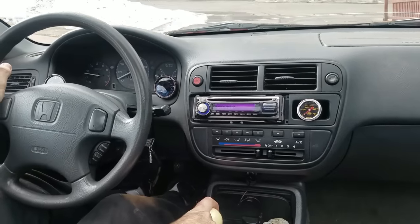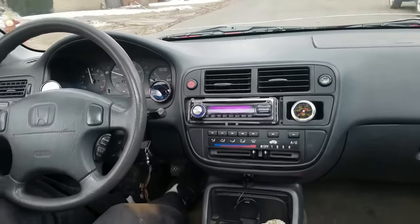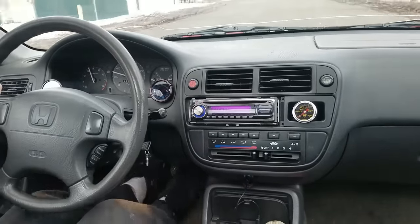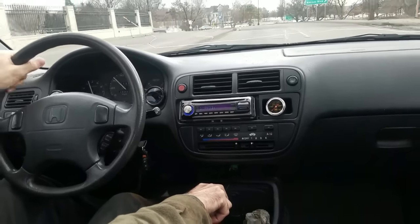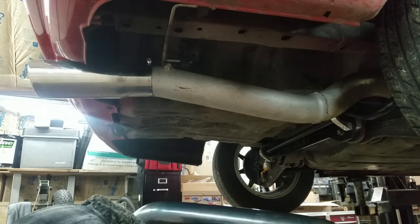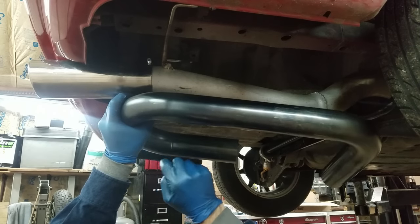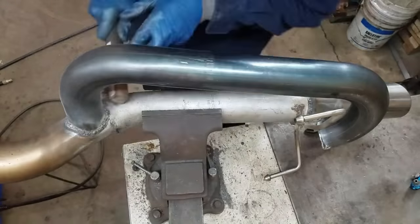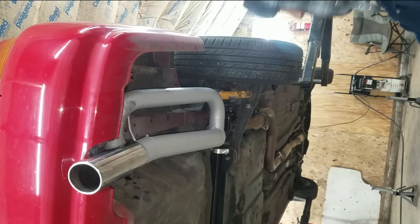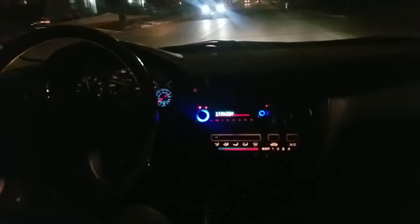This is a really common noise when you don't have a muffler — you don't really need one for a turbocharged car. We're at about 3500 RPM and it gets really annoying — that's a really bad drone. Basically what this does is take the frequency of the drone, make it travel up this pipe, put a stop on the end, and the noise travels back down into the exhaust to cancel out the frequency making the drone. I'm going to paint it. Hey — there's no drone! I can hear myself speak. Amazing.